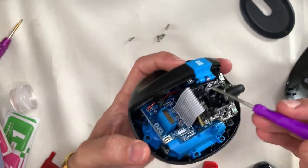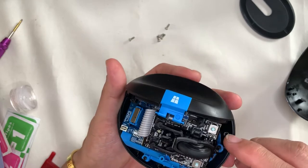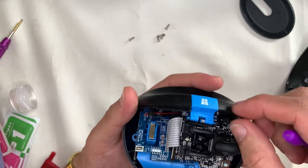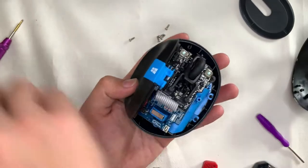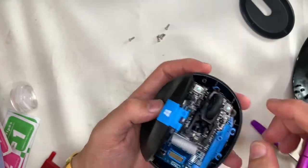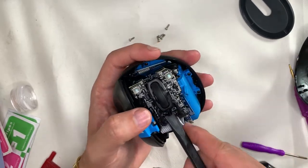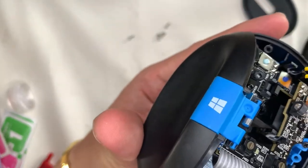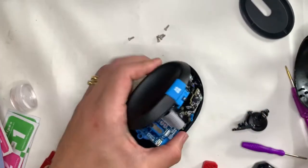Having a look at the inside of the mouse, it's a complex one. There are actually three separate boards — layer one, layer two, and a third. The mouse spec shows it scrolls forward, backwards, left, and right. The plan of attack is to remove the most obvious parts first to get them out of the way before accessing other screws — in this case, the scroll wheel. Use the appropriate size spudger and pry it off its clip. Be careful as most mice have a spring underneath to retract it back, so don't lose it.